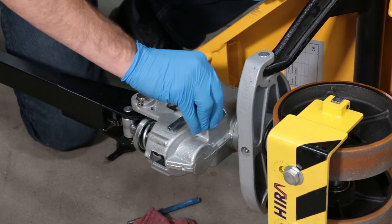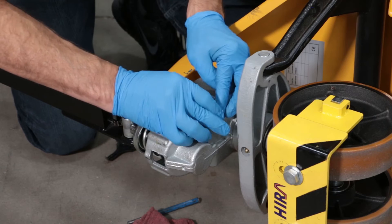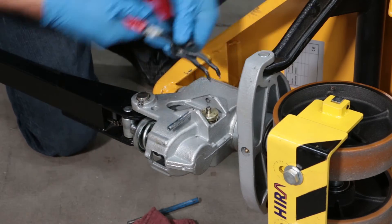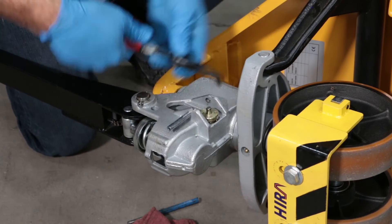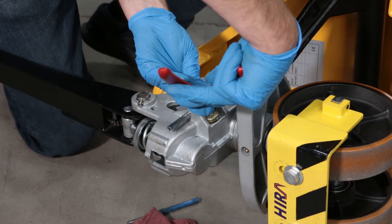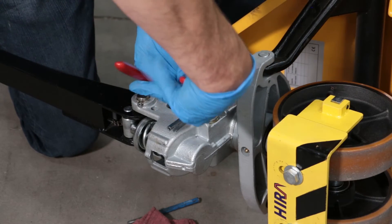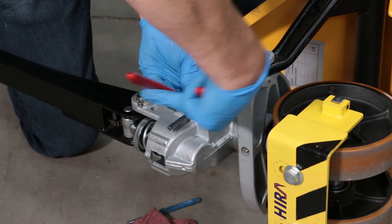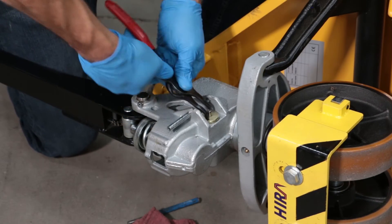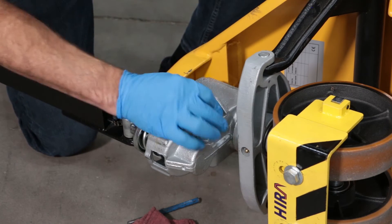Insert your new valve into the port. Because this valve is sealed with O-rings, we do not need to tighten it ultra tight like you would if it had a copper washer or a seal washer. Really snugging it up is plenty. Once you feel it getting tight, just keep turning it — I can feel it wanting to stop, so I'll give it another eighth of a turn. That should be good.